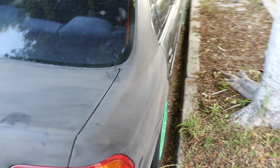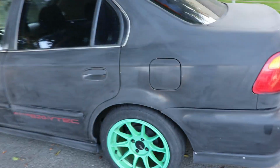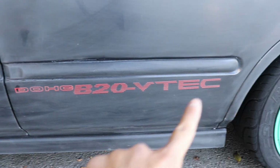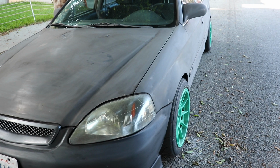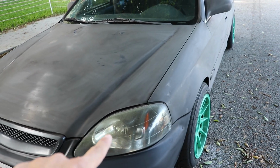And let's talk a little bit about the sanding. When you're doing the Raptor liner job, you want to scuff this thing up really, really nice, basically no shine. To do that, I usually just go with the 150 grit sandpaper, but you can actually go down sandpaper grits to find the sweet spot. You don't have to go down to bare metal, as long as the paint is in good shape. That sanding will promote adhesion so that the Raptor liner will bite onto the surface.